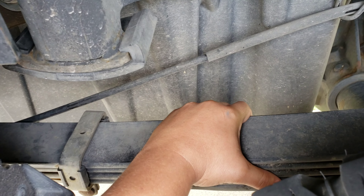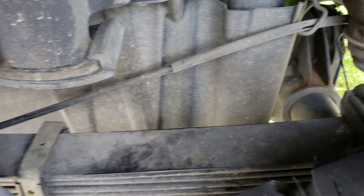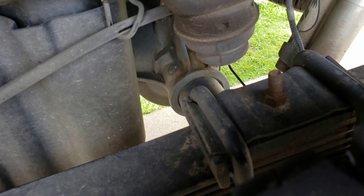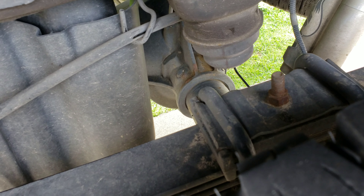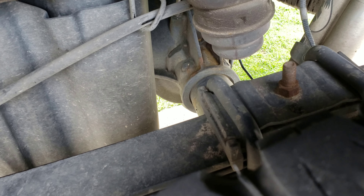So we're going to change out these rear leaf springs — basically convert the back end to mimic a Chevy 2500 — and then we're going to add 5,000-pound Firestone airbags on the rear with a compressor, and that is going to give me the ride quality that I'm looking for.